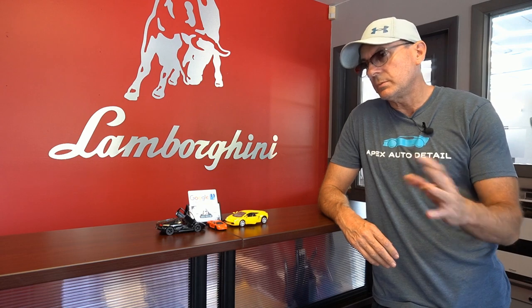The water-based transition is because it is safer for those who spray, body shops and manufacturers. It is safer for the environment, not so good for the vehicle. Thinner, very soft, and I can tell you paint protection films were about 25% of the work that we put out here at the shop years ago, and that has transitioned along with the water-based clears to being 75% of the work we do. And it needs paint protection film to protect it from rock chips because it is thinner and softer.